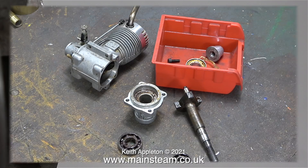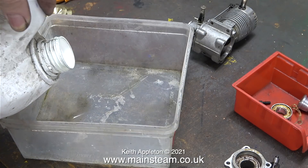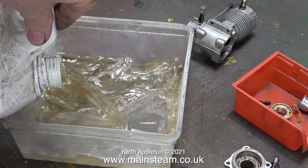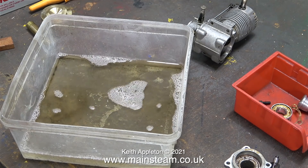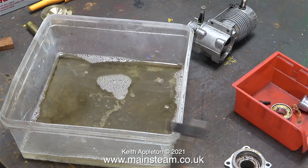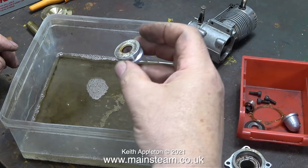This is as far as I'm going to strip down this engine - I'm only really concerned with the main crankshaft bearings. In the next part of the job I'll be putting some of the parts in my ultrasonic cleaner. But before that, to soften the very badly gummed up parts, I'm going to put them in some gun wash. This is like cellulose thinners but it's used for cleaning spray guns. The crankshaft goes in first and as you can see, that's in a bit of a state too.